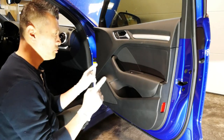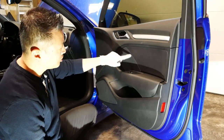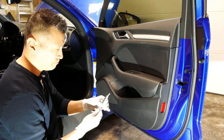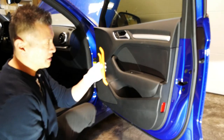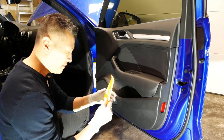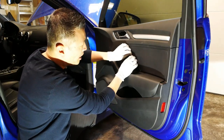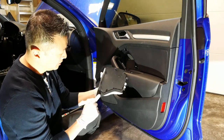Removing this door panel is actually pretty easy. This piece right here is the speaker grille — you want to go ahead and remove it. It's going to hide two bolts, and then there's a third bolt right here. If I recall correctly, it's going to be a T25 hex or Torx bit. I definitely recommend getting some plastic trim panel removing tools — they will do a world of service for not marring things up. Just get right in the middle and slightly pry it open, and you can hear it pop.